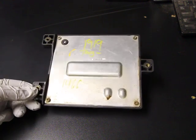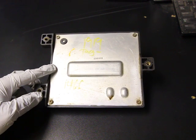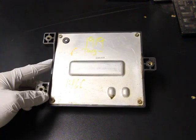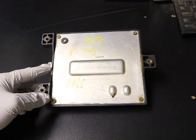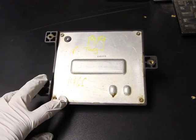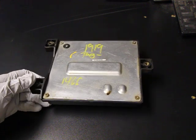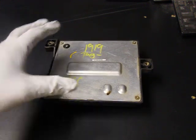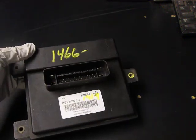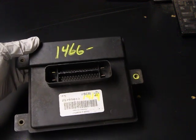As you can see, this is a used one — we're using it for demonstration purposes of sealing the backside. You can see where it's bolted to the metal back as well as the plastic side. They use some silicone sealant to keep it watertight, but where they're located up under the spare tire, water just gets to sit in there. When you take these things down, a lot of times you'll find the pins have all been corroded out and these things are full of water.